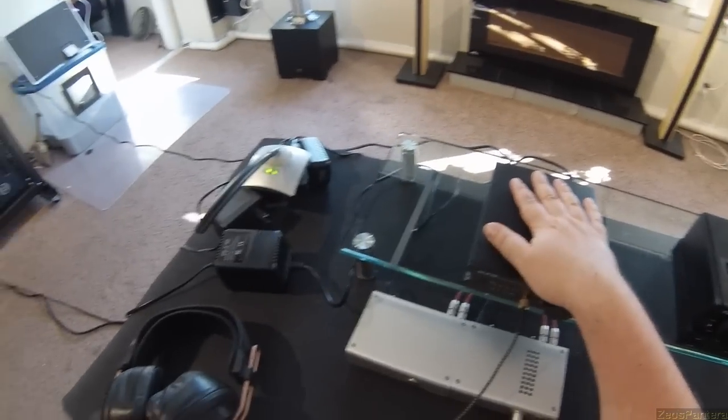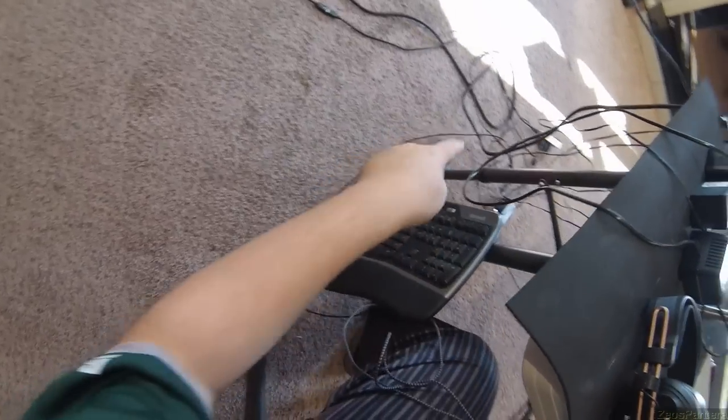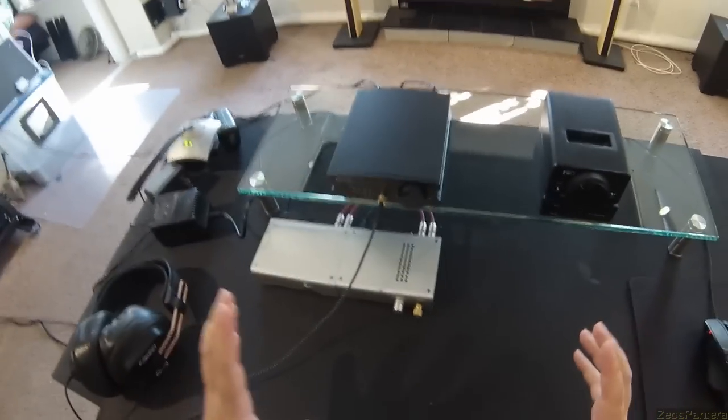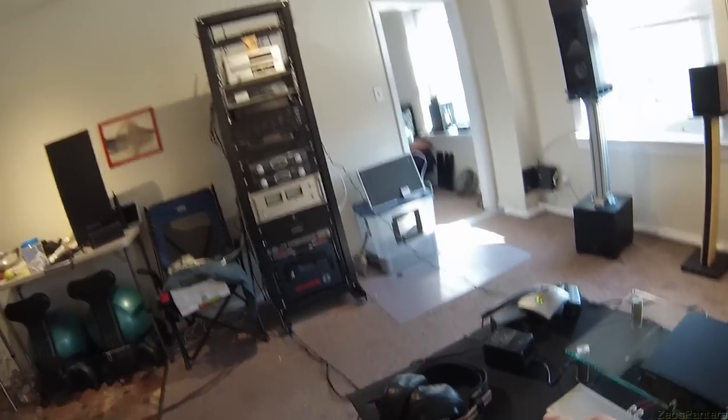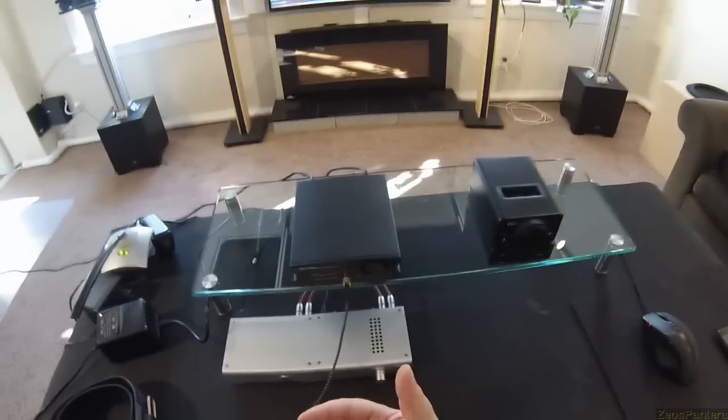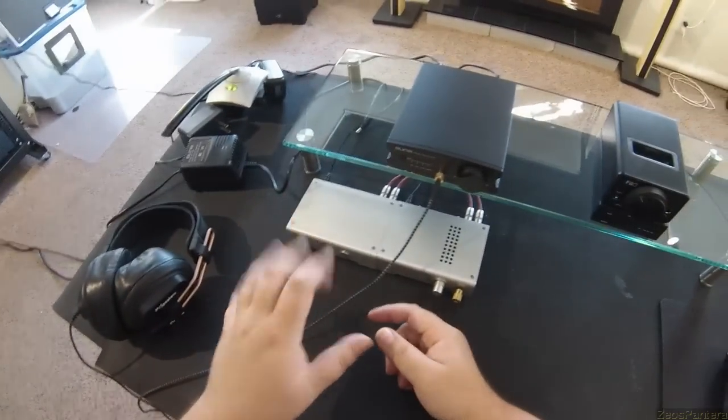It does not like hubs. I have a hub down there where my keyboard, mouse, and everything is plugged in. When I plugged this into it, I was getting crazy loud static. It might just be my setup because my setup has a lot of quirks. But if you're going to use it, try to use it direct to the motherboard. It also came with a USB cable, which was a really nice one.